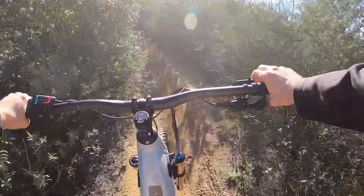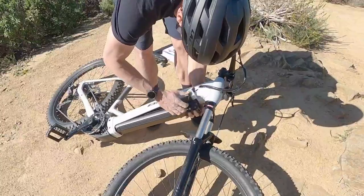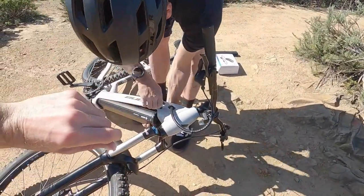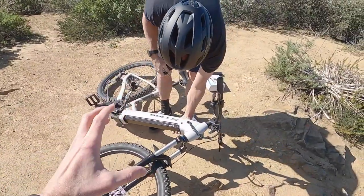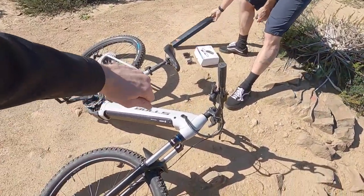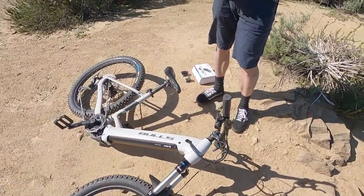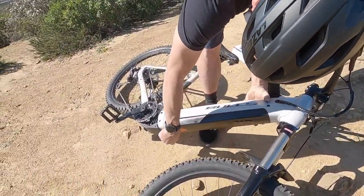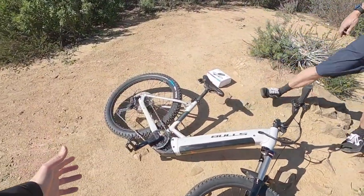they're really durable. I think at this point, we can start to put the battery back in, line it up at the bottom, and then as he gets it close, you have to actually twist the key in order to get that second step. It's really a two-hand exercise. Not only do you have to hold and support that 9.4 pound battery, but you need your other hand opening the slot with the lock, and then it gets into the first step and then the second step by force. We get the shield back, line it up just right, and then make sure you push that little switch down so that this doesn't fly off as you're riding.